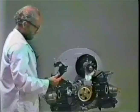I did notice that this one part of the fan shroud is bent a little bit, so we can screw in a little bolt like this and bend it back the other way, and it'll straighten it out pretty nicely. I have two of the Zenith side vertical shrouds that have already been massaged like that. All you have to do now is take a pair of pliers and bend this up. Don't be afraid. The powder paint usually won't crack.